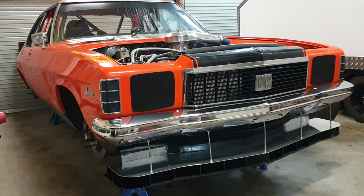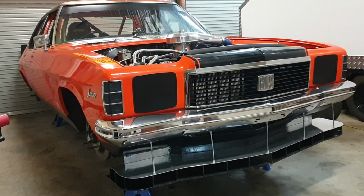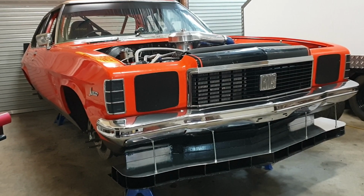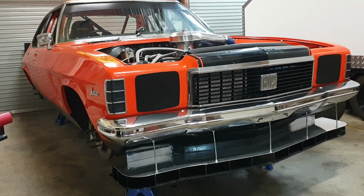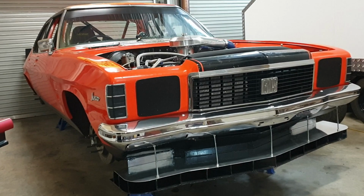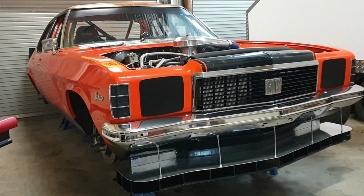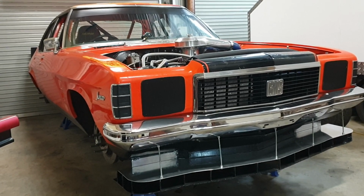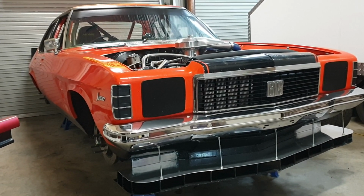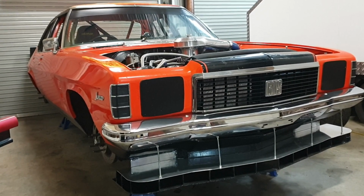I think now to get it perfect, or close enough, possibly another 2 sizes on the left side and maybe 1 on the right side. I'd like to see how that equates. But I'm going to review the footage and get an idea from before I pulled the jetting out, get some data on that and compare it to later when I did make a change. And I'll gauge off that.